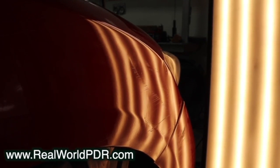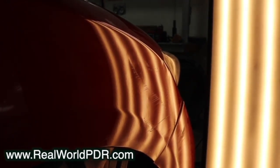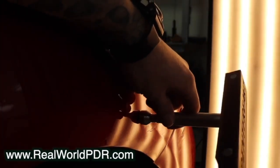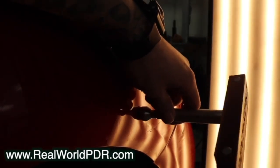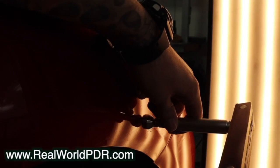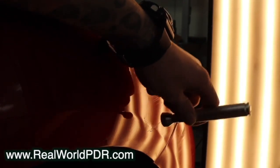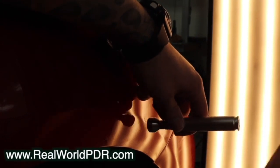Don't jab with hard tools in places where a soft tip will do the trick. Don't ignore what your dent map is telling you — where are the pressures trapped? What the dent's willing to give you is what you want to attack right now. Knocking down is more important than pushing in PDR. Let me repeat that: knocking down is more important than pushing in PDR.